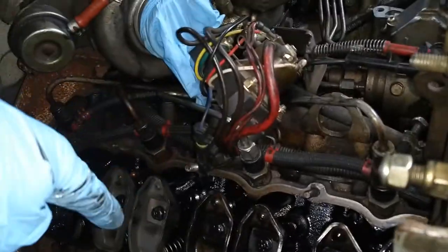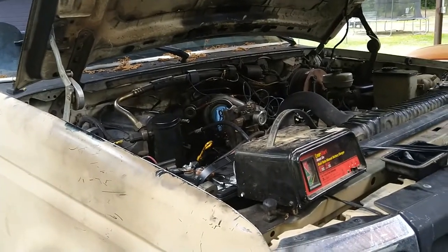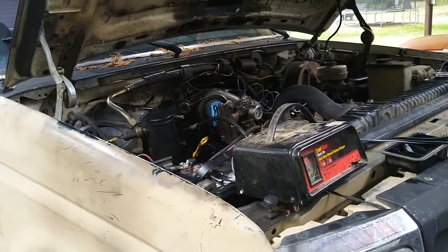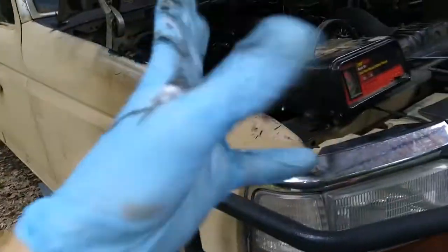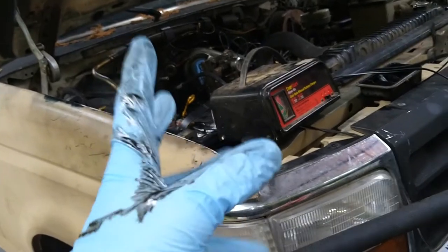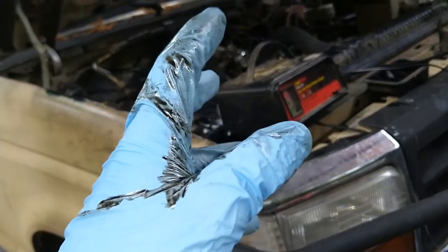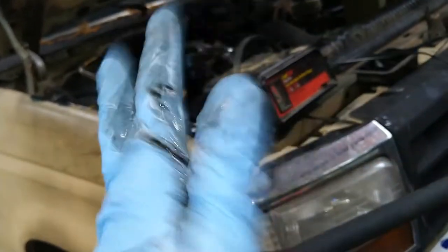Really about 22 foot-pounds, because I wanted to be a little generous on my cheap old torque wrench. There's the new rocker and new push rods on it. I need to change the oil quickly, toss in a new filter, and then try to dry-start it without fuel just to watch it all cycle without making a huge mess — I want to run it without the valve covers.